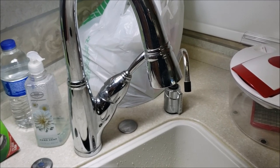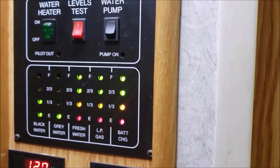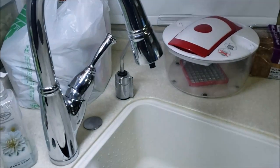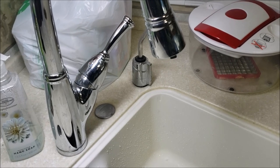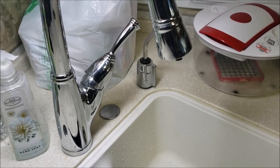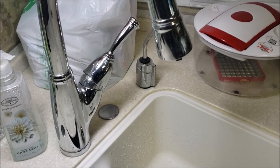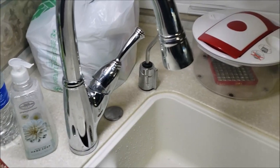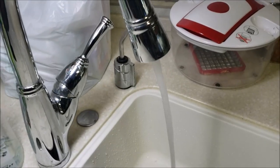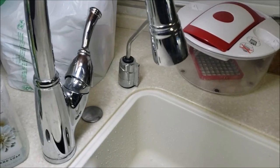I'm trying to duplicate the problem again. What I'm doing is bumping the switch to get the water pressure off, because if the flow gets too fast I believe the spring is broken in the check valve and that little disc is just flopping around in there. There's a check valve on the backside of the water heater — I'm pretty sure it's on this one; I've seen this before in other RVs.